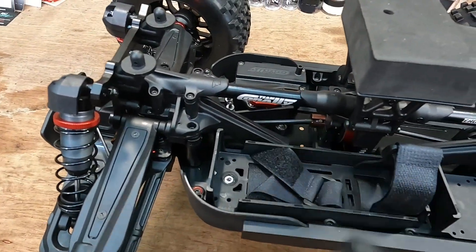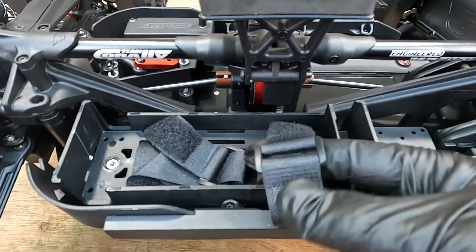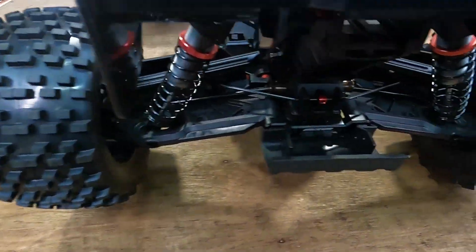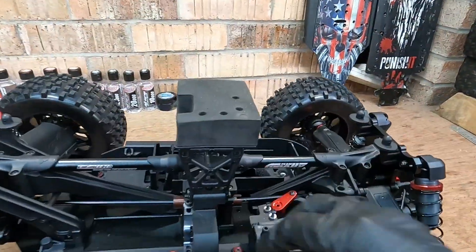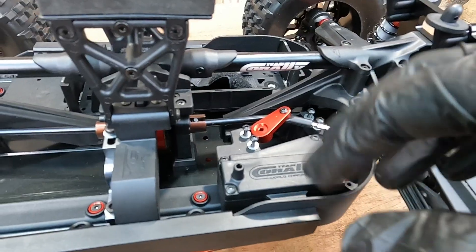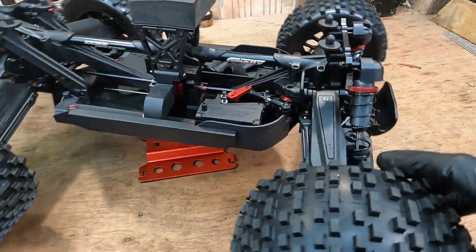If the cells at the top can get crushed at the front they'll probably become faulty. I'd also like to see a center back strap on the battery tray, as the two Team Corally straps don't last very long - I have broken my Chronos ones. On the wing, as a basher it doesn't really need all those adjustment holes - that area becomes a lot weaker because of them. One setting on the spoiler would be sufficient. The receiver box and servo mount - I'd like to see this sealed in future. I've lost a receiver because of water ingress. When I do my electrical install I will show you how I seal the box.